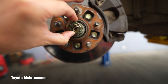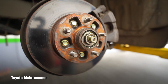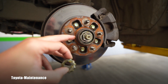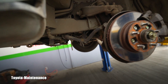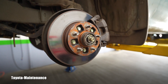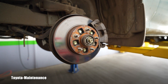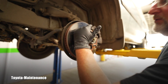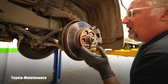Now what's the task here? You might say just torque it and tighten it — but if you over-tighten this you will put too much tension on that bearing, overheat it, and destroy it. This is a fine dance, like a ballet — you need to get right in the sweet spot. Nobody online has a clear answer for that sweet spot. A few articles agreed it should be torqued to 21 foot-pounds.